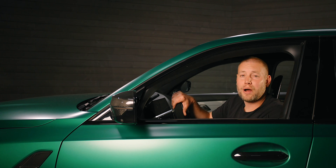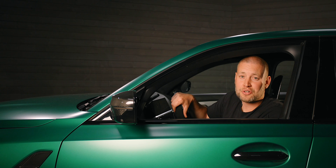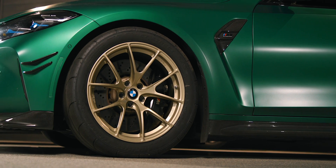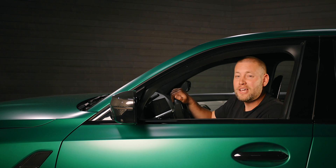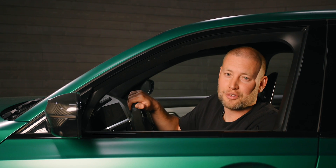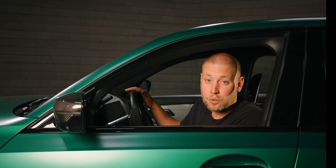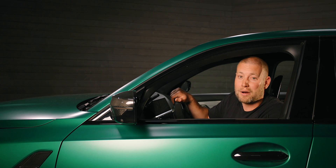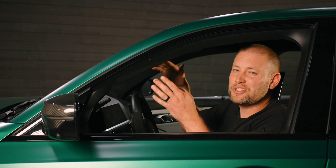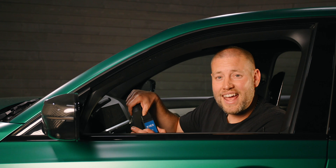Hey, this is Brian. Thanks for watching Keys. In today's video I'm going to show you how to solve an issue I've been experiencing at the track. If you have Mickey Thompson tires which you want to run super low — under 20 PSI — because these tires grip like no other, the problem is that's great for track times but your car is going to be freaking out the whole time. Your tire pressure sensors aren't going to want to reset and you're going to get an error on your iDrive screen saying you're limited to 50 or 80 miles per hour, which if you're trying to hit 150 miles an hour on the drag strip, 80 is a real bummer.